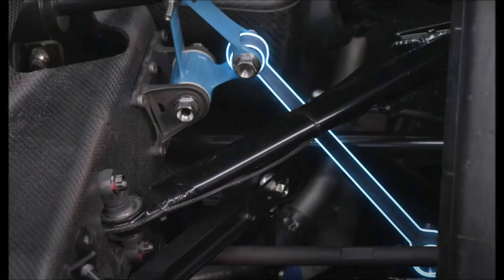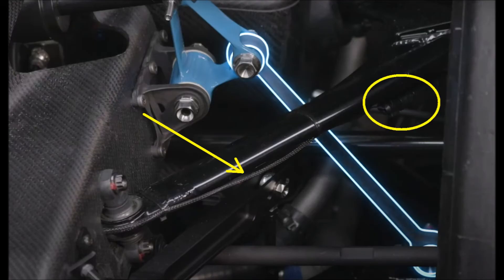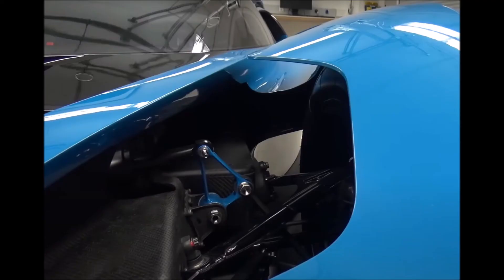As predicted, it's a pushrod suspension. The pushrod and the rocker have a nice flat shape. You can see the water pipes run below and you can also see the drive shaft in this picture. You can see the wheel speed sensor cable — I think it's the wheel speed sensor cable and you can see the standard VW connector for it. You can see very nicely the shape of the rocker here. You can also see the ratio which is approximately one to two, which means that the coilover is moving more than the wheel. It's quite common on sports cars to ensure a sensitive reaction of the suspension to small wheel movements. The car moves less and it's a more stable aero platform.